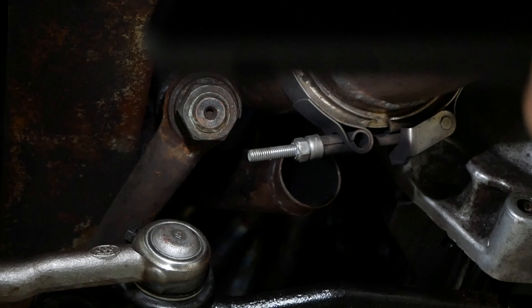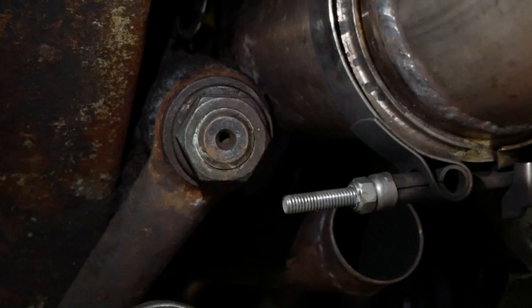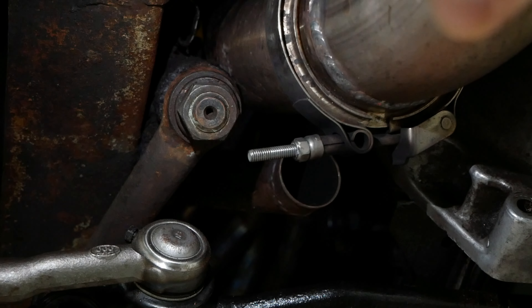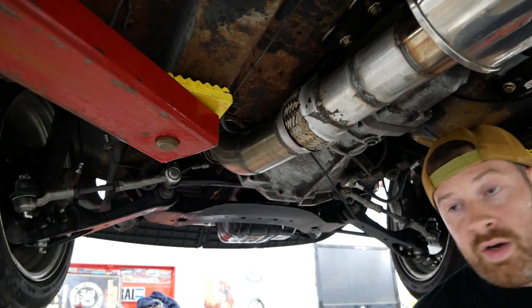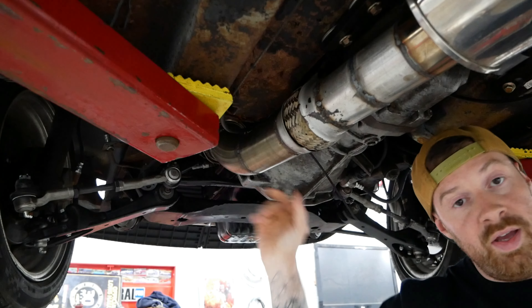The last couple of weeks, I did get this car driving and started to tune on it just a little bit. Not that I'm great at tuning, but I started to work it up to making a little bit of boost. Then I noticed a grinding, sort of vibrating noise that started — I could actually feel it in the steering wheel. When I drove the car back home, I also noticed it seemed like a louder exhaust leak. That's when I found the cracked downpipe. Believe it or not, the thing has cracked so far that the downpipe is now touching the pitman arm right off the steering box. I believe that is what my vibration sound and feeling was.